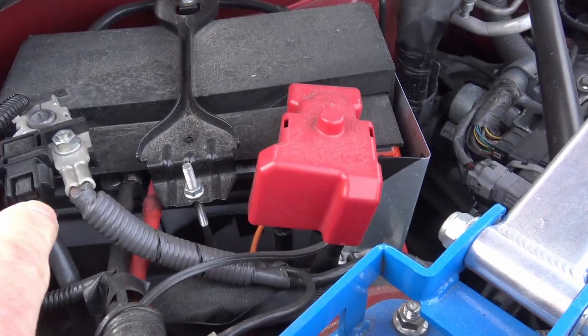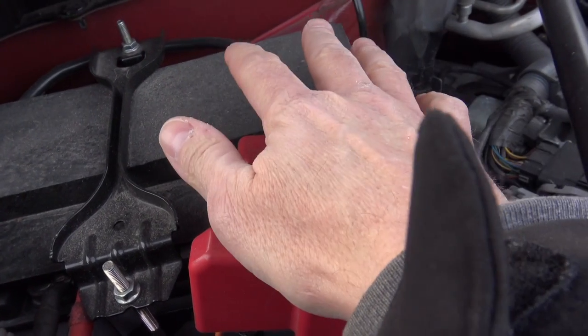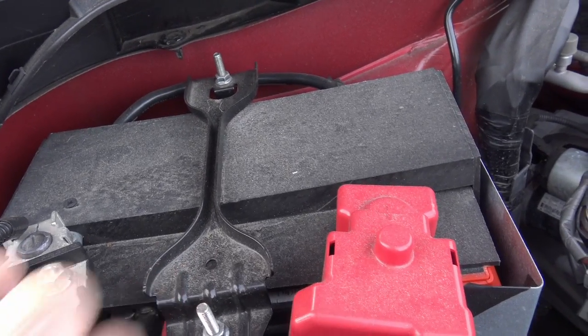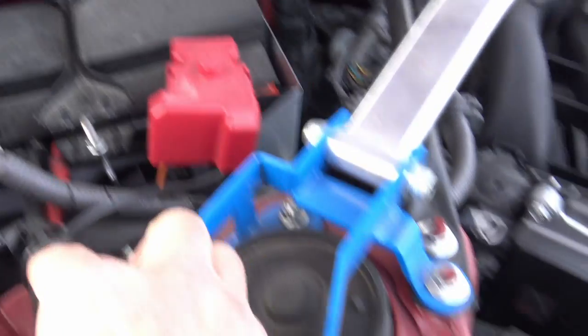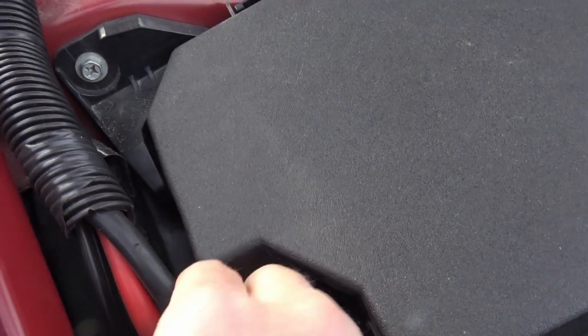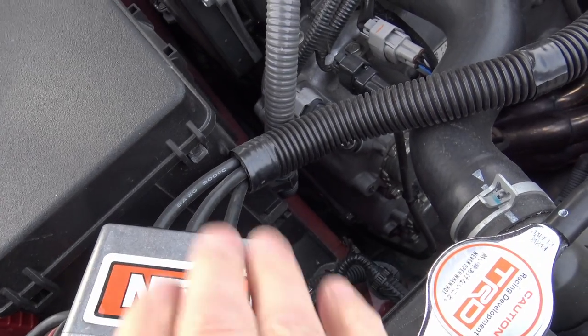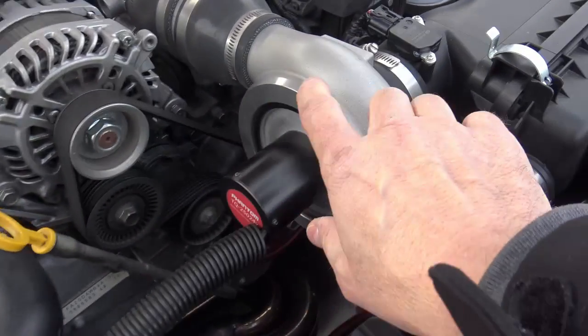The first thing I'm going to do is show you the basic parts of the Phantom Electric Supercharger. As you've probably already seen in my previous videos, under this cover we have three batteries: an Odyssey 626 battery that runs the car systems, and two small AGM batteries connected in series to produce 24 volts. That goes down this cable to the controller via heavy duty connectors. The cables are quite large so there's no power loss. This controller controls the charging and discharging of the batteries to the electric supercharger.